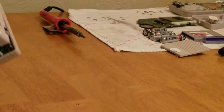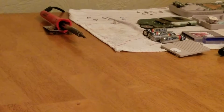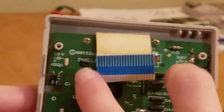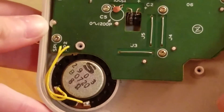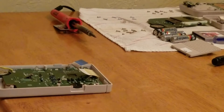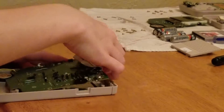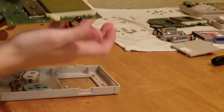Next you're going to want to carefully remove the ribbon cable from your system. The back half you don't really need to worry about, but if you are going to clean this, you'll want to take out the four screws in there and take it apart. There are ten screws in the front half — two up top, two there, four in the middle, and two at the bottom. Once you have all of that sorted, take off the front half very carefully and you'll expose the front PCB.